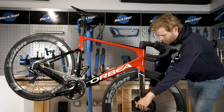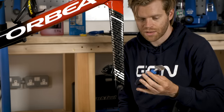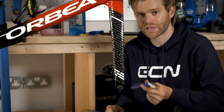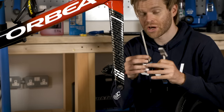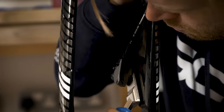The first step is to remove your front wheel. We're now going to reset the pistons and I'm going to use this specific tool. If you don't have this tool and you're just using a flat head screwdriver, you can use that, but just be careful. Be gentle because you don't want to go in too hard and gouge the brake pads as you can damage them.